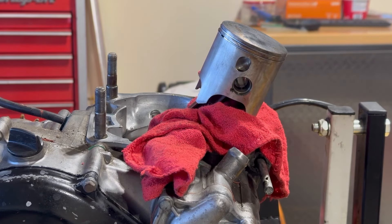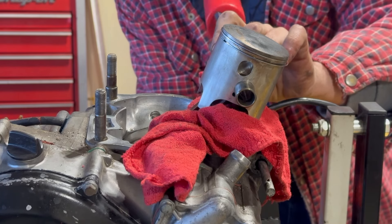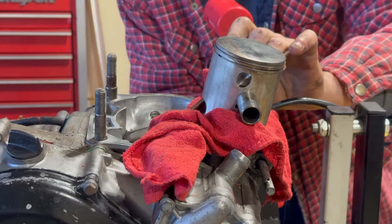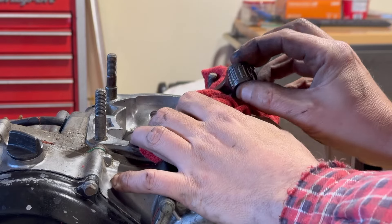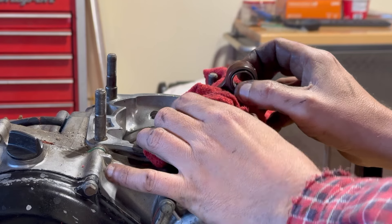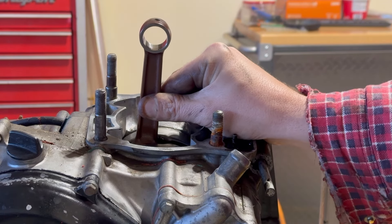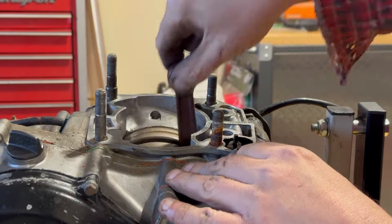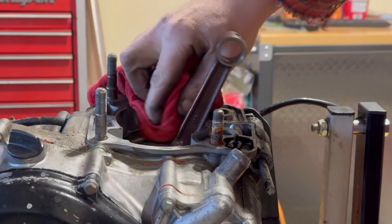It's almost like nobody put assembly lube in it — it feels pretty stuck. I'm going to tap it out gently. Somebody bought a piston kit, but the bearing I think is the wrong size. Let's take a look at the crank and see the play. No up and down play. Other than having some water down in there, that's pretty good. I bet there's nothing wrong with this bottom end, other than this case.